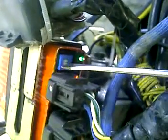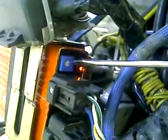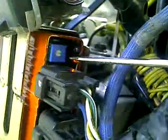The green is for the TPS sensor. Using this dial with a flat screwdriver, turn counterclockwise to advance the timing, and turn clockwise to retard the timing. The maximum advance degree is four degrees and the maximum retard is also four degrees.